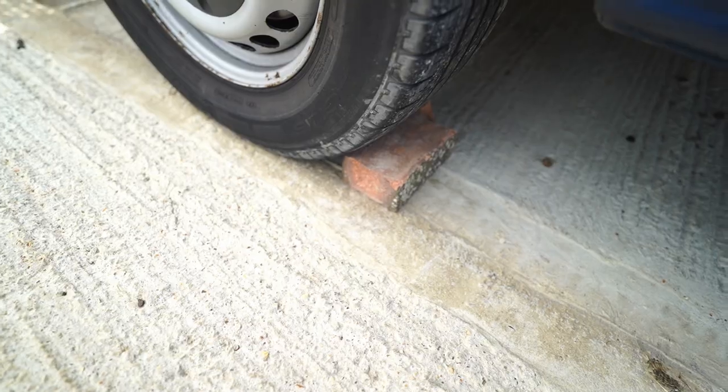The very first part of this job is to make sure your work environment is safe. I've chocked the back wheels with a couple of bricks so there's no chance the van can roll forward — we're on a very slight incline on our driveway. Number one: make sure the van's not going to go anywhere. The handbrake's really good on this van and it's in reverse gear, so it really shouldn't go anywhere, but belt and braces — chock the back wheels. The next thing you want to do is uncrack the bolts on the front wheels before you jack it up. Once you jack up a rear-wheel-drive vehicle in the air, there's no chance you'll be able to undo those nuts without the front wheels spinning. So while the wheels are still on the floor, make sure you uncrack the bolts on the front wheels.